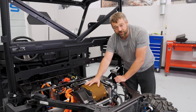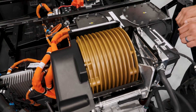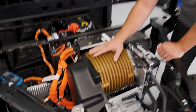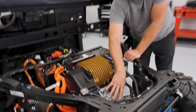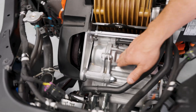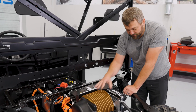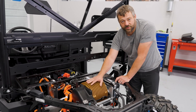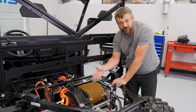We've got three-phase power going to this giant electric motor — it kind of looks like a stack of dinner plates back here, but those are all cooling fins on the motor itself. It's coupled to a drive cog belt underneath this cover that goes right to the input shaft of the transmission. This is a standard-style transmission like you'd see in most other Rangers. The difference is that it has park, neutral, low, and high — there's no reverse gear in this gear set because the motor can spin both directions. The controller controls both direction and speed of the motor.